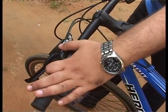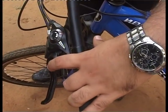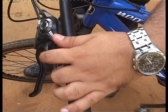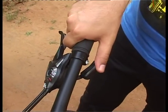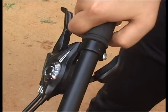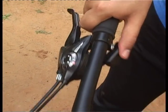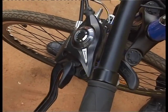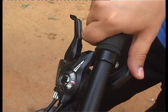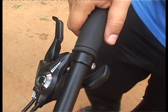Now let's see how you go back. We're at three in the front derailleur and seven in the rear. Press the lever on top to move the front from three to two, and press the other lever to move back from seven to six, five, four. Then move the front from two to one, and continue moving the rear from four to three to two and back to one.